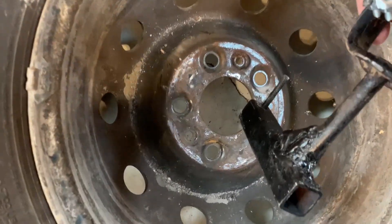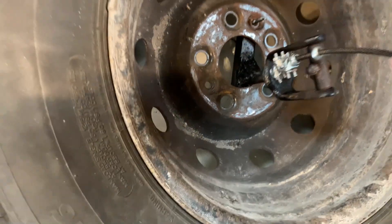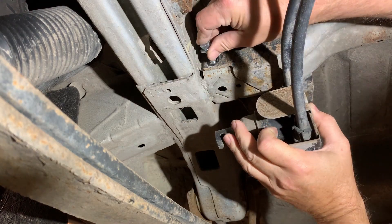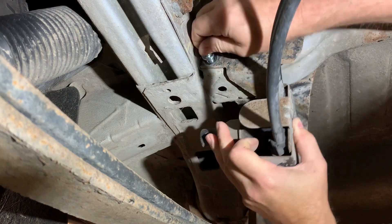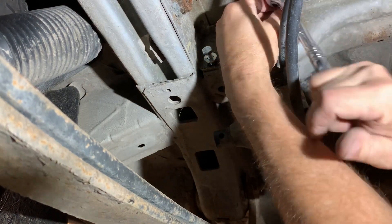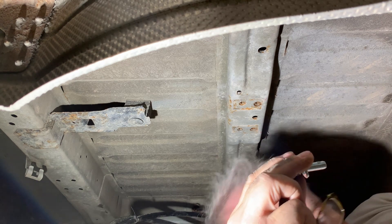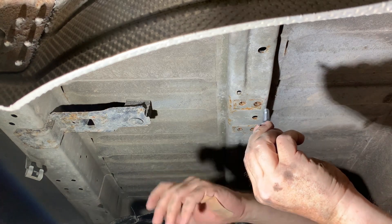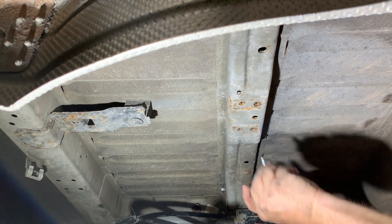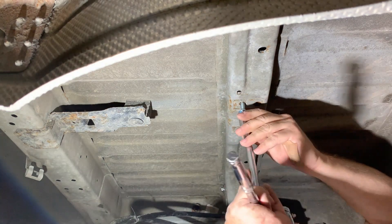Here is a close-up on how my retainer assembly captures the wheel. I completely removed the entire RAM spare tire winch system to see if the unit itself was serviceable. It's just eight M8 bolts — 13-millimeter sockets will do the trick. Here I'm reinstalling the unit using new hardware. They've done a decent job on the center hanging point. The unit is designed to slip into one of the four retaining bolts, allowing the bolt to hold the hanger in place while working above your head.